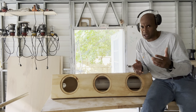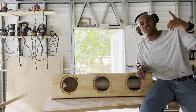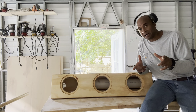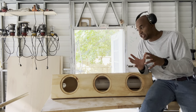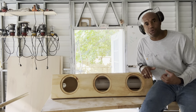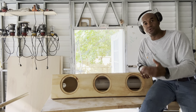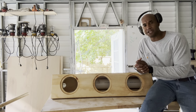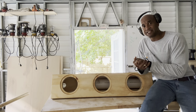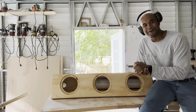Possibly you can get the box volume up to 1.6 or 1.65 if you utilize two eights with a higher tuning. It all depends on what music you're listening to. That's why you get a custom box — I can tune it to the music you predominantly listen to and give you the best performance from your subwoofer enclosure inside your vehicle. To get the MB option, the number is 404-694-4818.